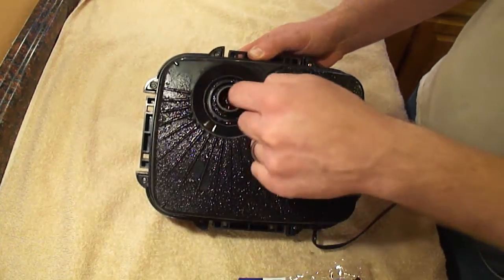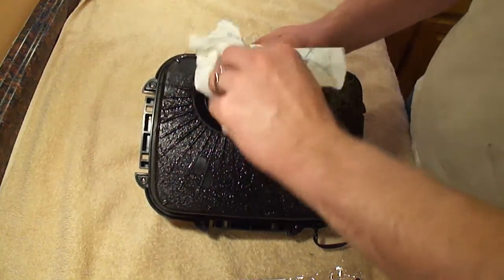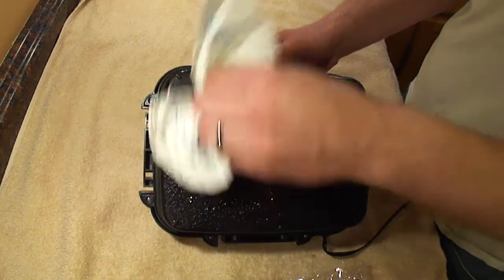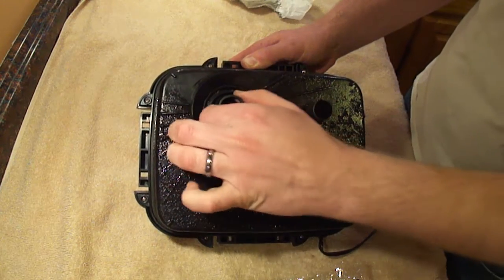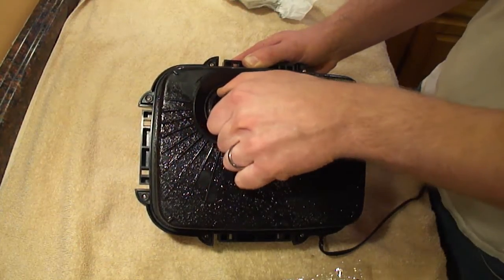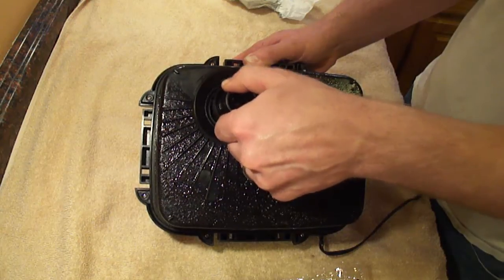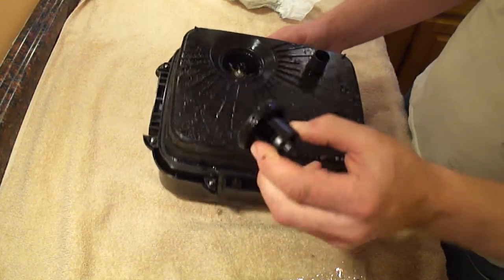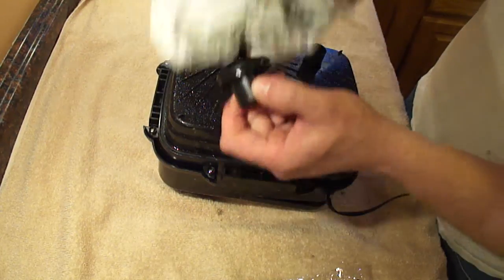What you do is, this little housing around the outside — first thing, clean it as best you can, try to get the gunk and garbage out of here. Then grab it and gently but firmly twist it counterclockwise. It's going to be in there really firm, but it will come out. This little piece is all that retains and holds the impeller down inside there.